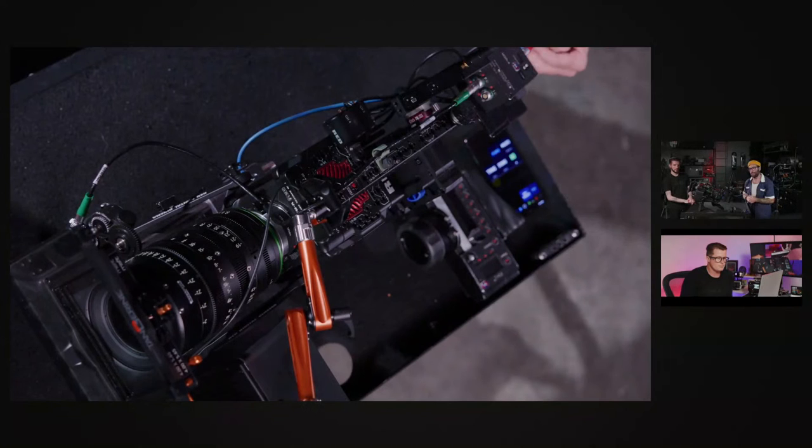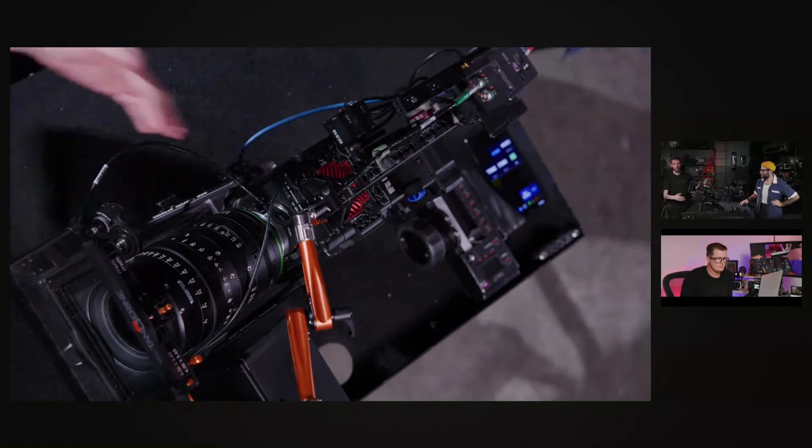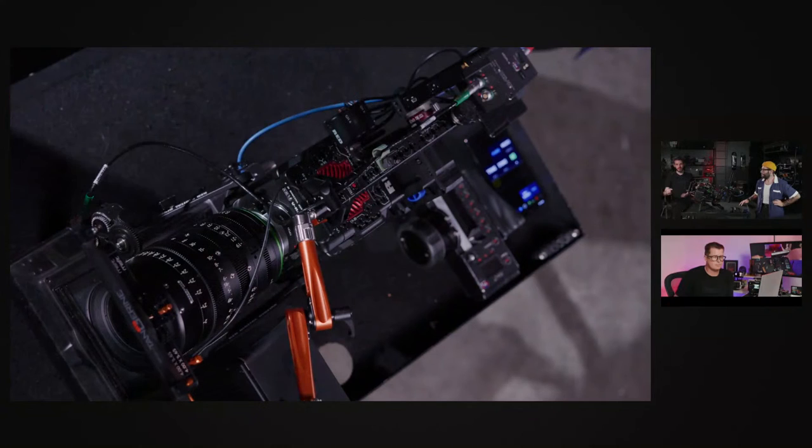I mean, especially with operating, people like to hold on to the batteries and these kinds of things, or if you've got an Easy Rig, or depending on if you've got a really heavy setup, like you have with this Primo Star lens, take some of these 3-inch or 5-inch pieces and put them coming off the front, because this front part of the handle is still completely modular. So you can tack these pieces onto the front if you've got a really heavy setup and you really want to counterbalance that a bit nicer. So again, just having a modular handle is really, really nice.